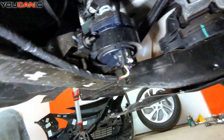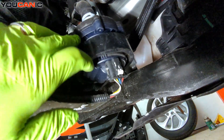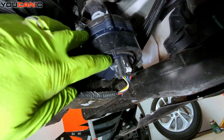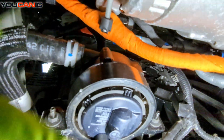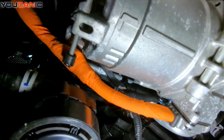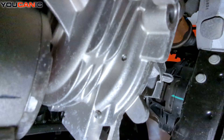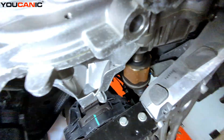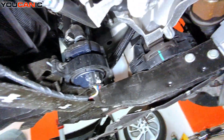Also here, close to the front where our radiator and fan are, we have a little circulator pump that helps cool one portion of the vehicle. We have another circulator pump over here that cools more portions of the vehicle. Being that we don't have pulleys driven by a serpentine belt, that's why we have electric circulator pumps.